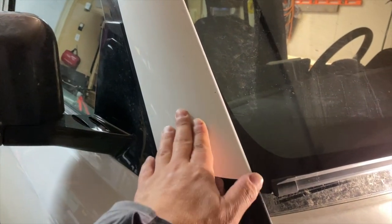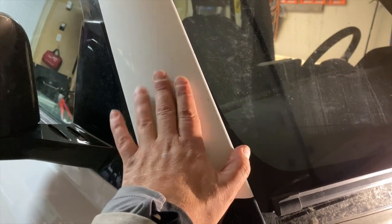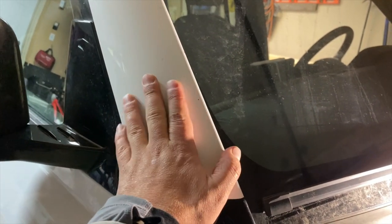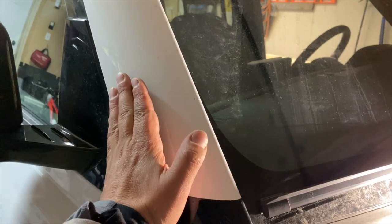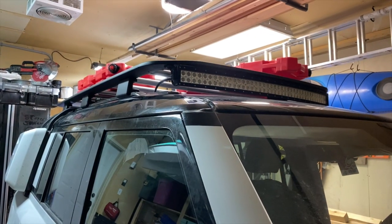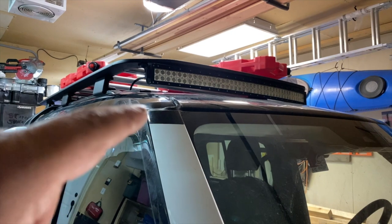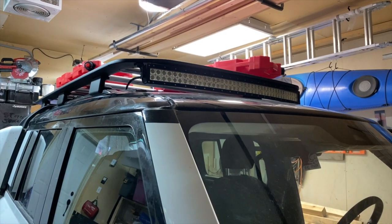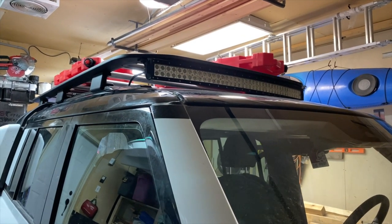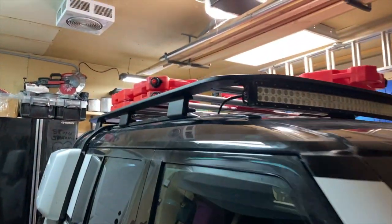The point of all this is that underneath here you have to have the three wires side by side like my fingers — you can't have them sat on top of each other in a mess because you don't have the room. Then I just put a piece of tape over them in various places to hold it. There are three wires going up here — not for this light but for the Steady light, which has side lights, so you need one wire for the side lights and another wire for the main beam light.